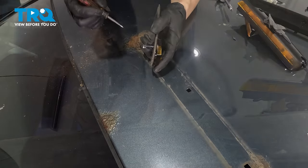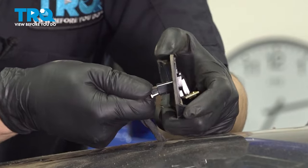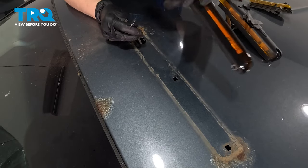At this point, let's grab a pocket screwdriver and pop this little clip up so we can unplug the old light — just like that. Don't let go of this cable. You don't want to lose it underneath the roof here.